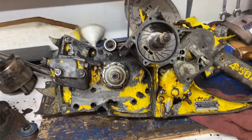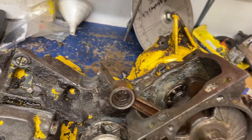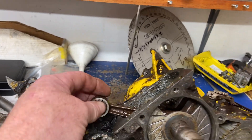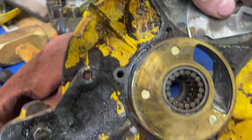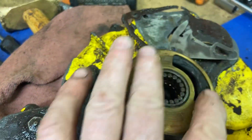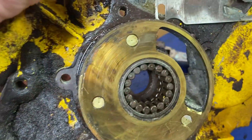The bearing on the other side is a ball roller bearing — it's moving fine. I finally got it moving. The rod bearings seem okay on the bottom, and the top has two cages pushed into the rod. The wrist pin came out quite easily. Here's the crankcase — it's got like a brass shield, and the rotor rides on this brass, and that's where the intake is right here. Very interesting — double needle bearings.